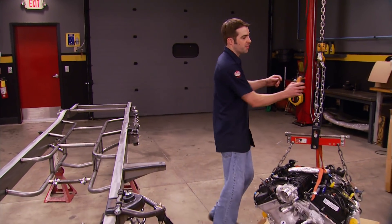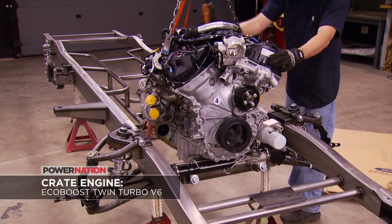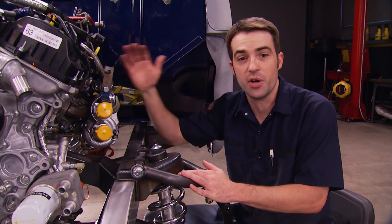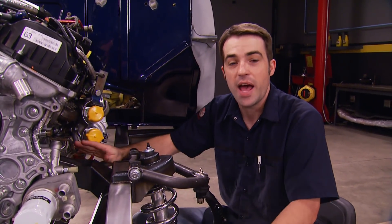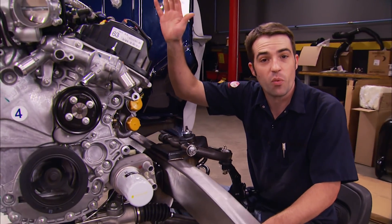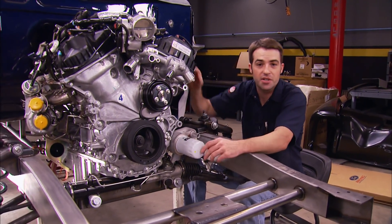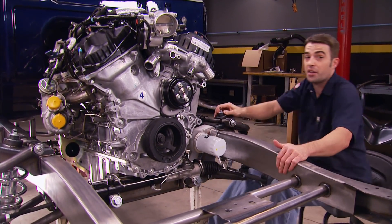The first step is mock-up. Between the last episode and this one, I had a chance to get a running start and already made the driver's side engine mount. When doing so and mocking things up, I had a few things to consider: I obviously wanted the engine sitting centered in between the frame rails, but I also had clearance issues to consider with the steering rack, steering shaft, firewall, and transmission tunnel. Let's take a closer look.